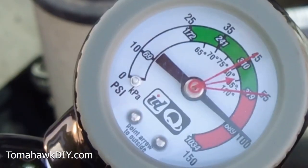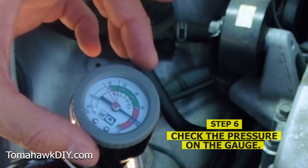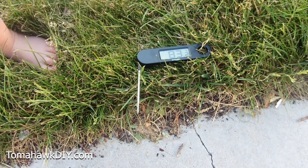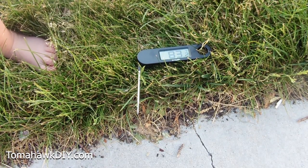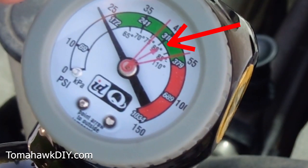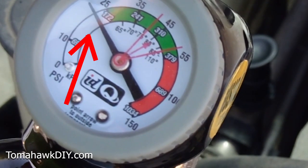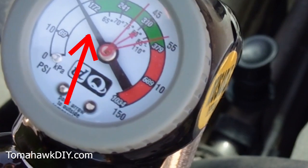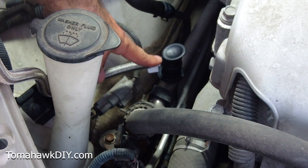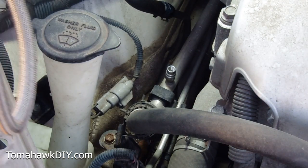You need to make sure the engine's running when this happens. The next step, we're going to be reading the pressure gauge here when the clutch is engaged. I'm setting the temperature — earlier we measured it was about 83, so I'm setting it halfway between 80 and 85. The pressure is down in the white zone, not up in the green zone, so we need to add some. After checking the pressure, we're going to take the hose off and screw the can on.